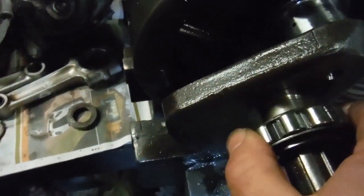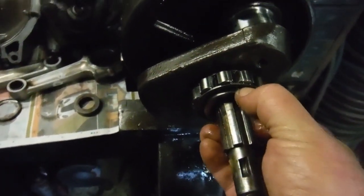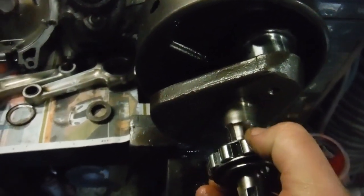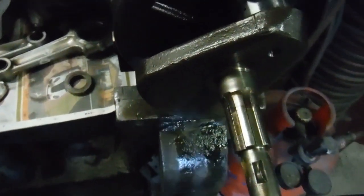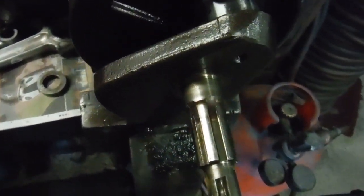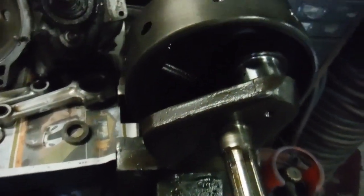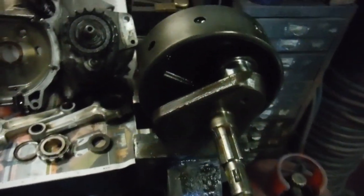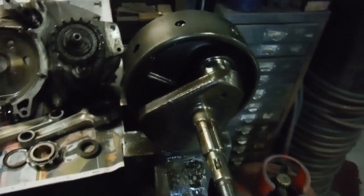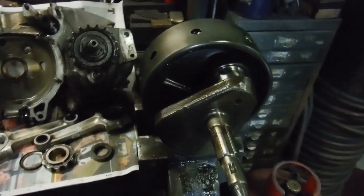Unfortunately this one is not very good, and I think there's too much play to try and take up with a bearing fitting compound. So we may have to look into the possibility of getting some metal spraying done and having it turned back to its original diameter. We've also got the timing side journal which is going to need a regrind to a suitable undersize, so it may even work out more economical to look for another crankshaft yet. That's where we are at the moment — unfortunately that's a rather unwelcome bit of bad news that we'll have to consider options to overcome.